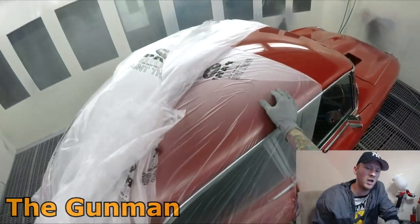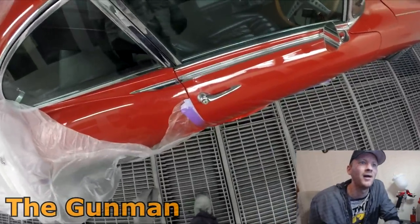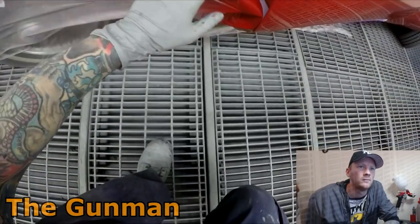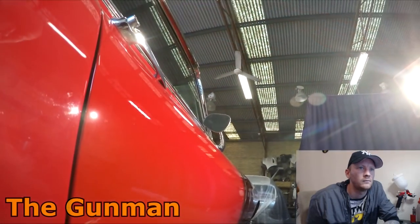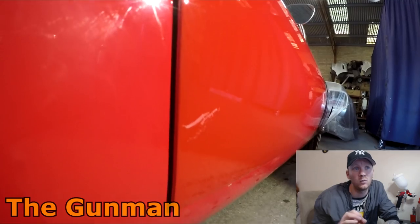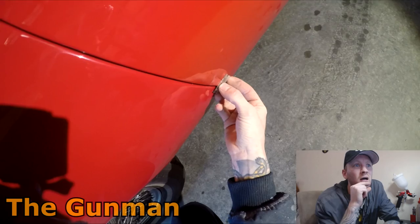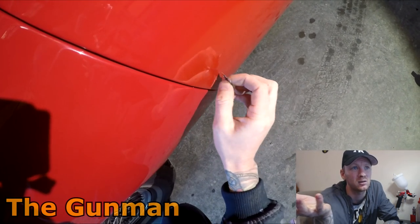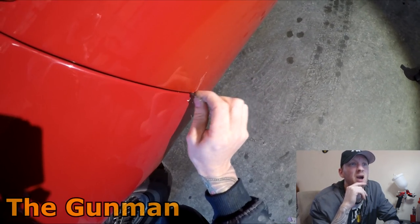I actually thought it was going to come out a little bit better than that. From looking at my color card — and that's another thing with colors, get a second opinion. I'd probably say 70% of the time I'll show a color to the other guy walking past and he might say 'yeah that's good' or 'put a bit of yellow in it,' yeah you're right, and you do a bit of an adjustment. I did opt to remove the masking when it was still wet. You can see it's maybe a touch on the orange side under this light — that's the sign that it's gone metameric.